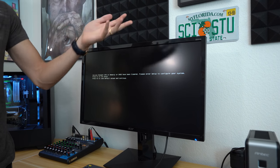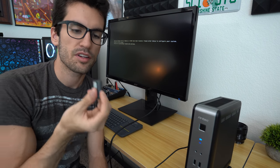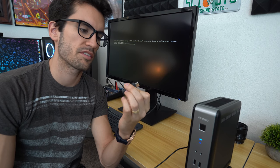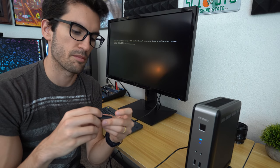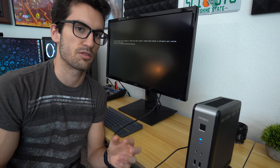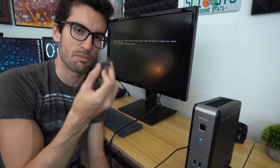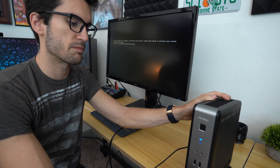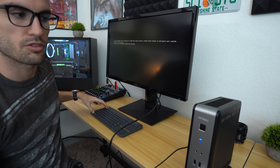There's the post — that's perfect. Now for installing Windows, I figured I'd cover that in this video since I didn't in the last one. You're going to need a USB drive — I have a 32-gig drive with USB 3.0 Type-A on one side and Type-C on the other. Download the Windows 10 ISO from the Microsoft link in the video description. That UI will tell you to plug in a thumb drive and load all the necessary software onto it, turning it into a boot device. Then connect it to the PC, and when you go into your boot menu — since there's no operating system on the drive in the system — you can have it run setup.